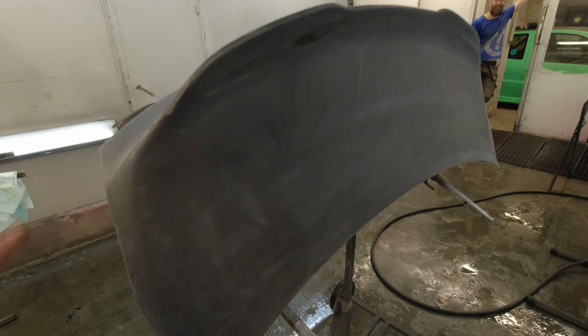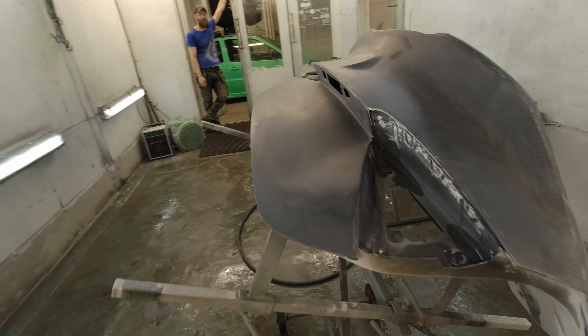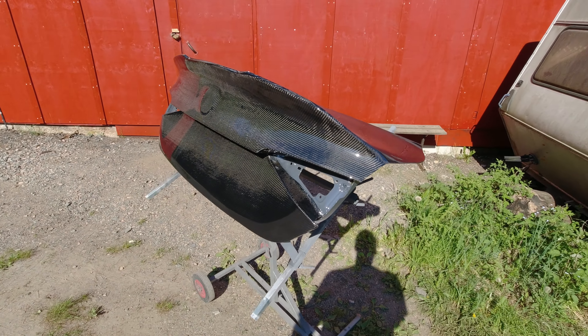Prepped in the paint booth and as usual wax and grease remover of course - prepped, wax and grease removed. Now begins all the layers of clear coat. What I usually do - and this is the tip - I spray it very very thin in the beginning because usually you have fish eyes. If you want the clear coat to get into the fish eye, you spray it thin like three times, let it dry ten minutes in between, then do the thick layers after that. That's ten years of laying clear coat on carbon fiber, for free, out here in sunny Sweden.